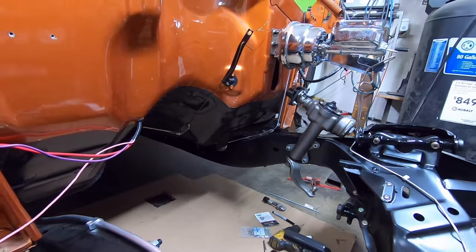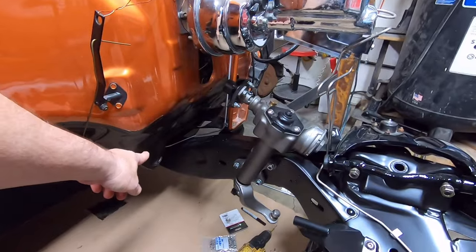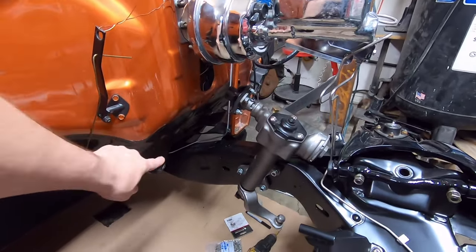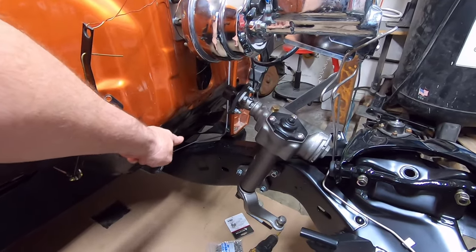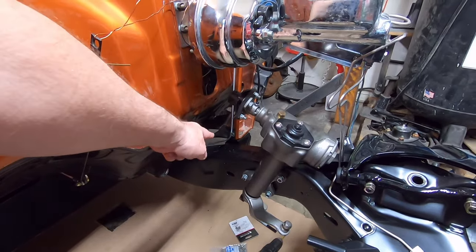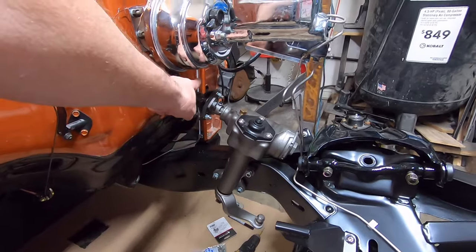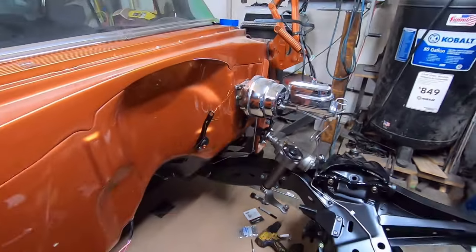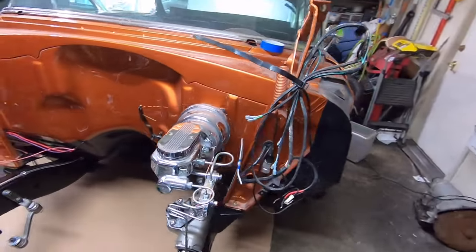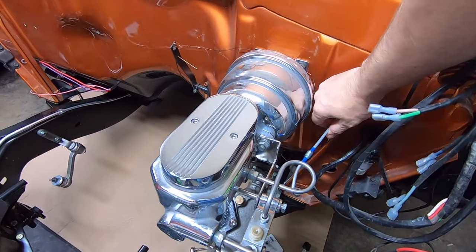The brake line is just about done. I've got it toward the top of the frame rail — nothing's touching the frame rail. I did some lazy bends so it wasn't a hard 90-degree bend. I drilled and tapped the body mount and put a clamp on there. I'm going to add one up a little higher too. I kind of followed the body line contour up there and it'll end up looking clean.